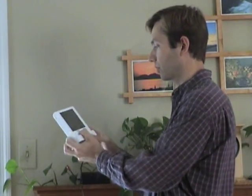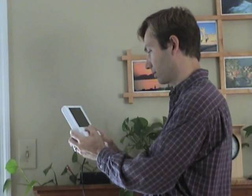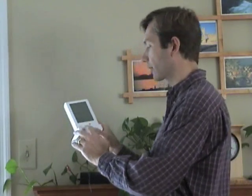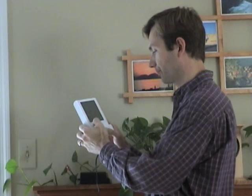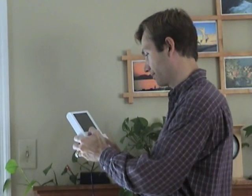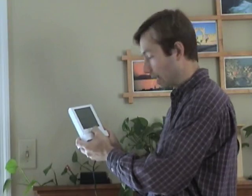The second part is to set the time. Hold the square button down for three seconds, then let go, and you'll see the hour on the clock change. This is a 24-hour clock, so push the up and down buttons to change the hour — remember you're in military time. Push the square button again to set the minutes, then push the square button again and you'll see the blue light — you're back to the normal screen. That's the second thing: the time.